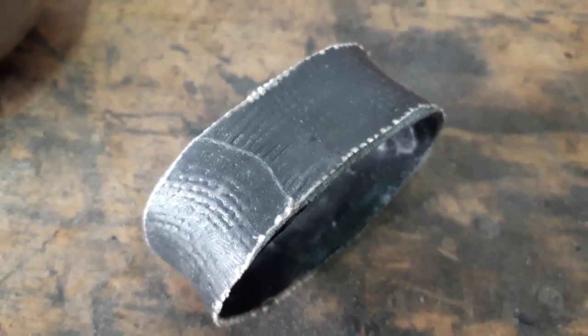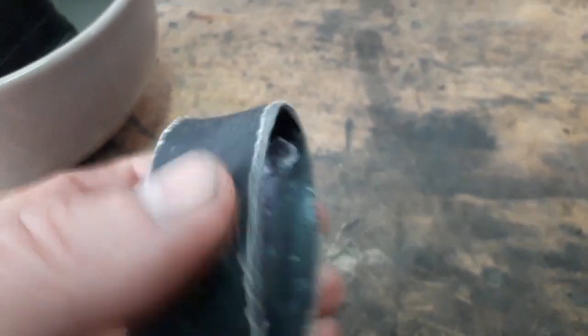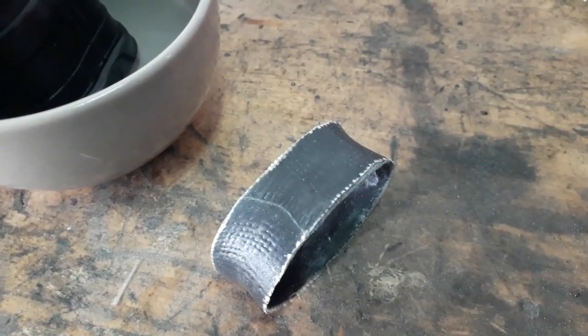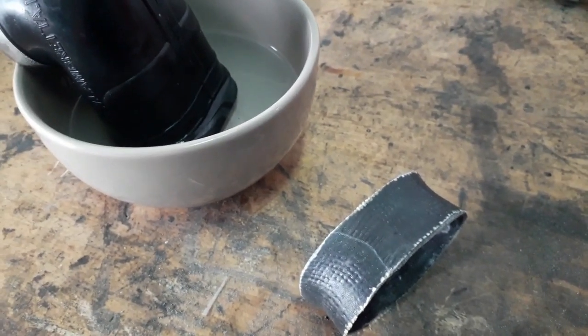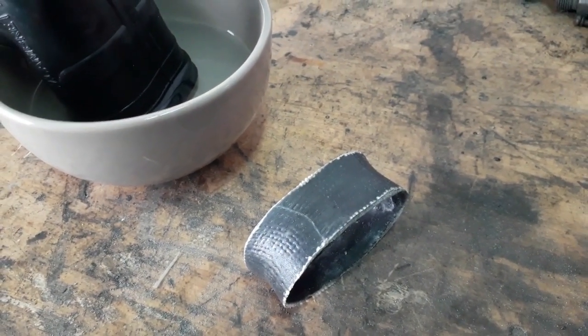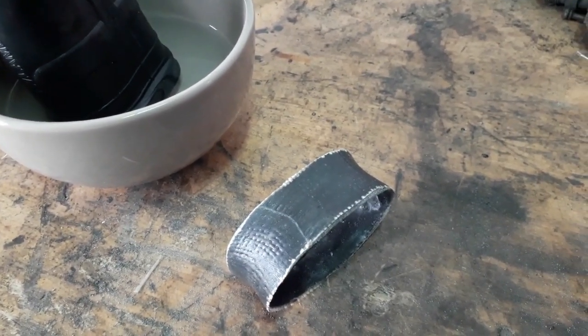That's my little fiberglass liner that we've now made. I've got my filter sitting in some hot water because I've made the liner slightly bigger so it's a tight fit — soaking it helps with fitment. We're going to slide it in and then later we'll be taking the bike for a test drive under hot conditions to see if it's sorted the problem.